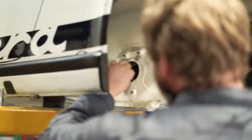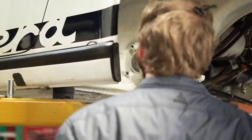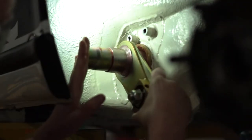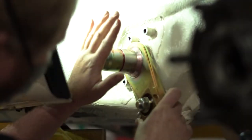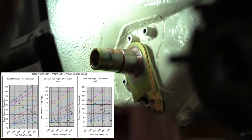To begin installation, we'll start by making sure the torsion tube is cleaned and prepped for bushing installation. Note that this is a coilover conversion. For torsion bars you would follow the same standard procedure and set the angle of the blade at this point. Be sure to read about the recommended angles in the included ASP notes.